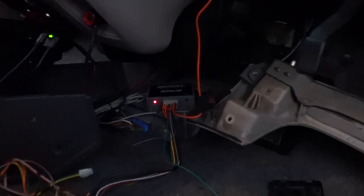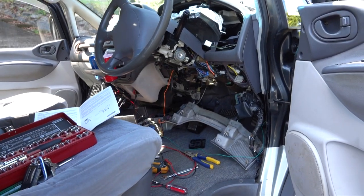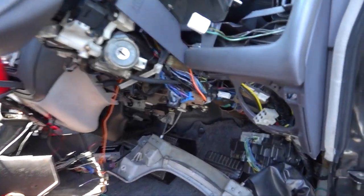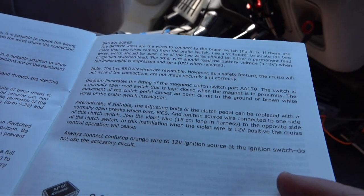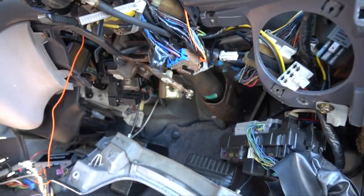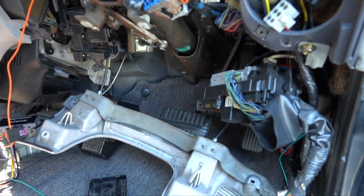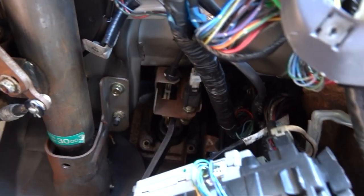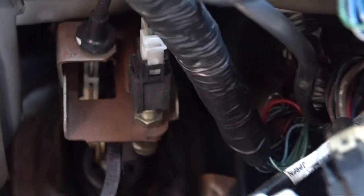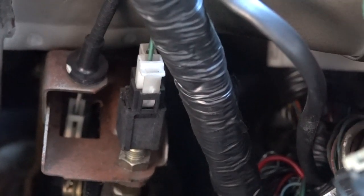At this point it's a good check to see if you're getting power. Turn on the ignition and you should get a red light on the control unit — that means you're good. The red light goes off after a minute but I think that's normal. Next it's time to hook up the brake switch wiring. The brake switch wire is the brown wire on the system. To get to the brake switch you're going to have to pull off this panel and remove the fuse box or at least let it hang down — the brake switch is that little white black-and-white unit there. The plan is to unplug that little white clip and splice into it.